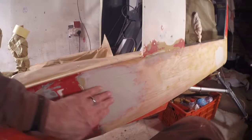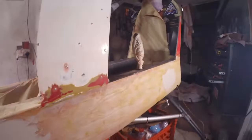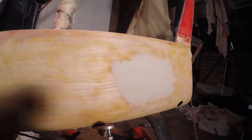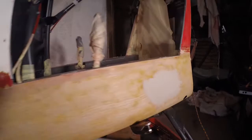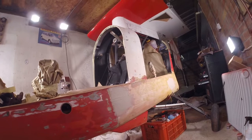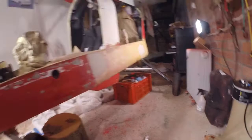Tonight's jobs: I'm going to sand this back and then see if it needs lifting up any more, and the same with the other bit we put on over here. Sand that back as well, look at the low spots, put a bit more filler on it. Tomorrow I'm hoping to mask it up and get a bit of grey etch primer just on the wood bit. Flat those bits of filler back, do a little bit more rubbing down underneath, possibly a bit of masking. I've got to mask up the undercarriage and stuff - make sure I don't overspray that.